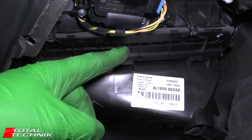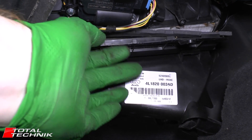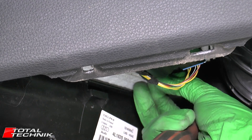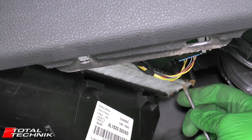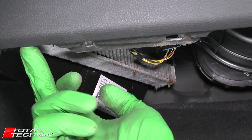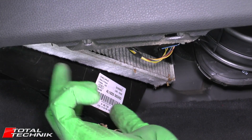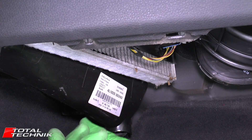Now we can reach up and remove this little panel. You may find the filter is a little bit stuck in — if it is, you might have to get a screwdriver under the edge just to get started. As the filter drops down it will get stuck on the edge of this plastic panel, so flex the plastic panel forward while manipulating the cabin filter in the opposite direction, and by doing both you should be able to slide it down and out of the way.